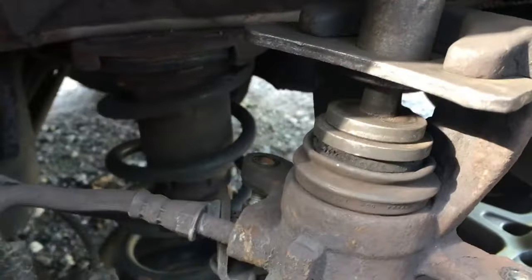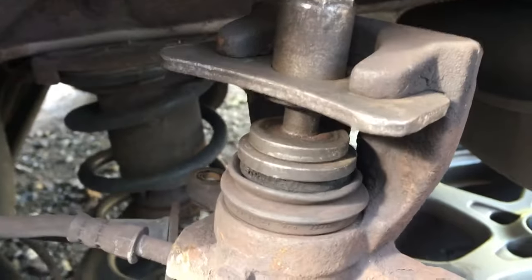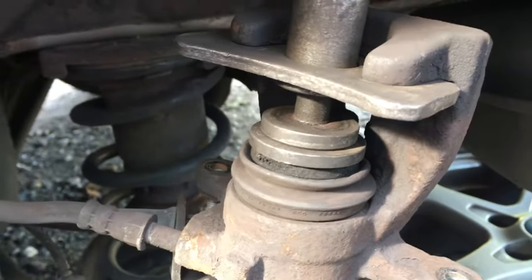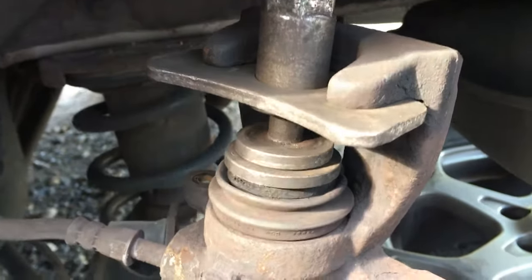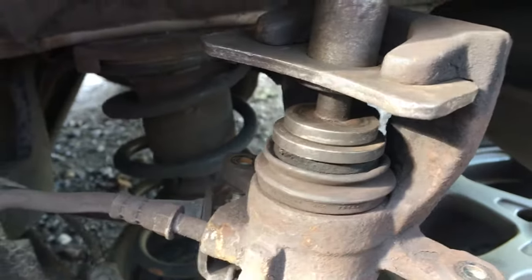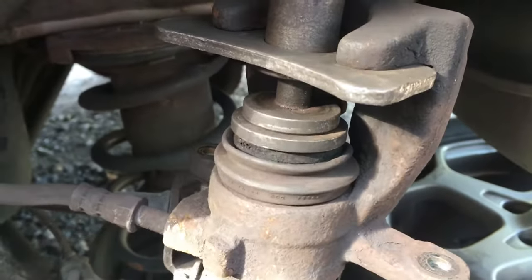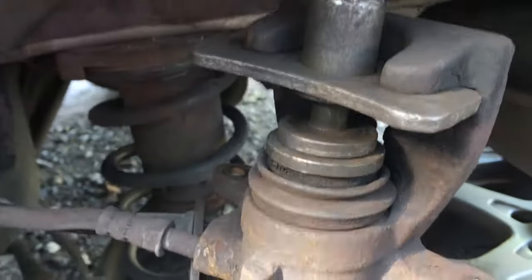Good afternoon. In this video we're looking at a brake caliper, and for this car the thing is working perfectly, but I just want to share some useful hints when winding down a brake caliper with an integrated handbrake. On the rear of the car, you may find that the caliper is not winding down easily or is very stiff to wind down.